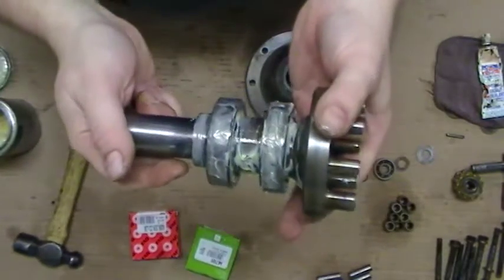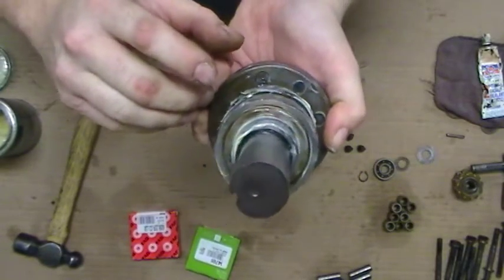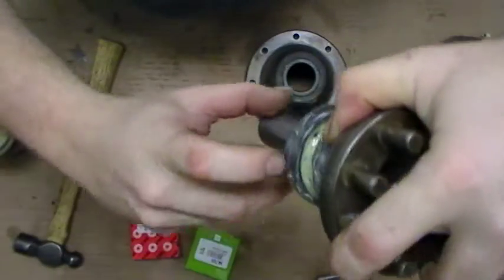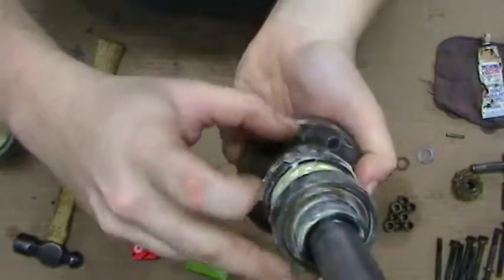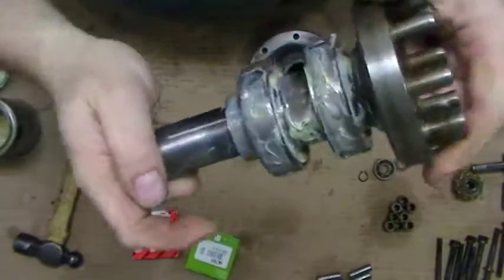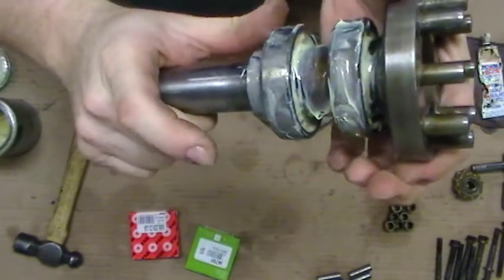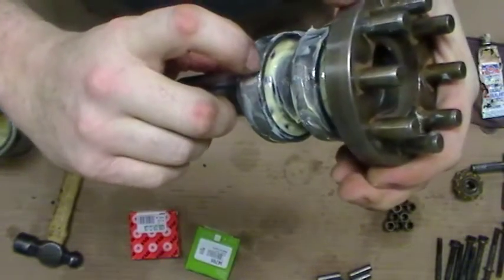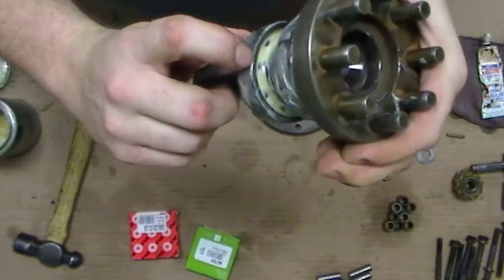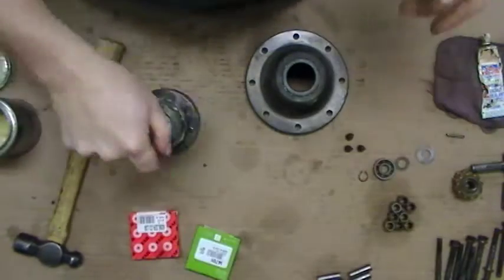This is the output shaft itself. These bearings originally are double shielded. You can see the inner shield here has been removed, the shield there has been removed, and the shield there has been removed. This one we leave in place to help retain the grease. If you're using new bearings, make sure you get ones with metal bearing cages, otherwise the plastic will disintegrate and all the balls will fall to one side — you'll have trouble with it.